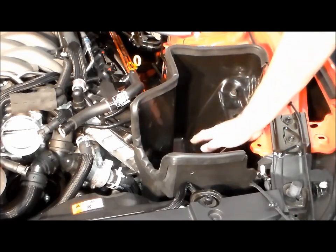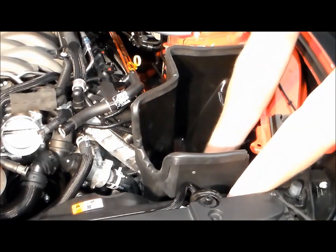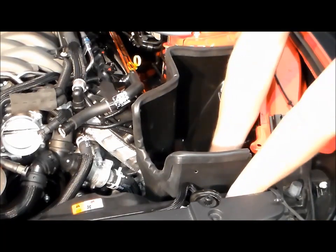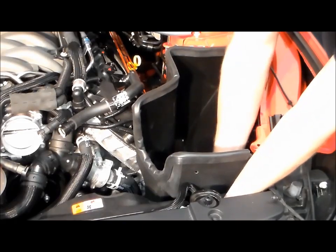and now we're going to connect the fresh air duct. Reach inside here, you can feel the factory one. Slide our piece forward, get them together. If you need to, that factory one is flexible. Squeeze it in a little bit, slide this forward. You should just have some of the duct at the edge of the heat shield.